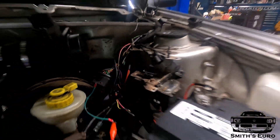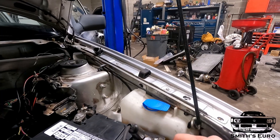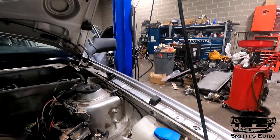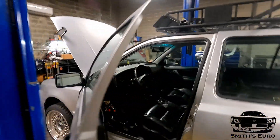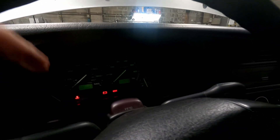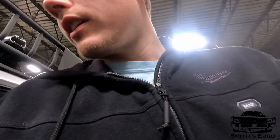Now how do you test it? Obviously always be careful with this type of stuff. Have a test wire jumper here - watch this, it's now connected. And guess what? No more power at the end of it. Why? Because it's completing the circuit, coming all the way around back into the battery and going back out - it's happy as a clam. So you come over here and now look with that ground connected - look what I have. I have my gas gauge, I have the lights back on, I have the coolant gauge buzzing telling me there's nothing going on, have the oil buzzing telling me there's no oil. That's the easiest way to find a ground.